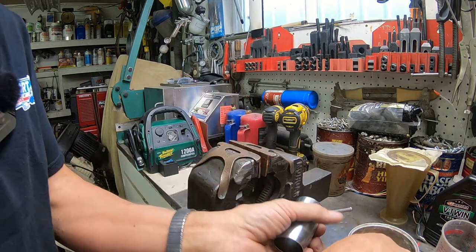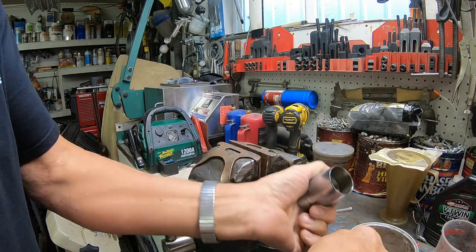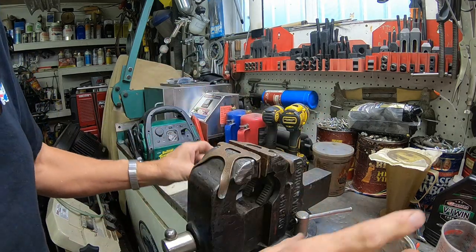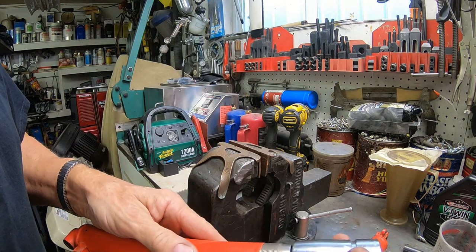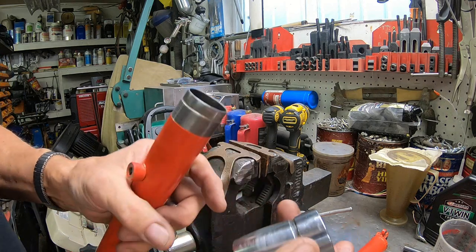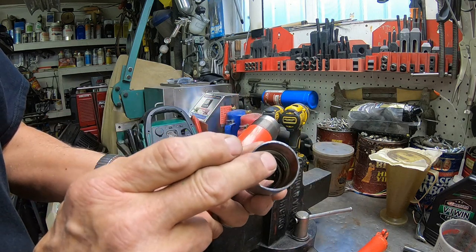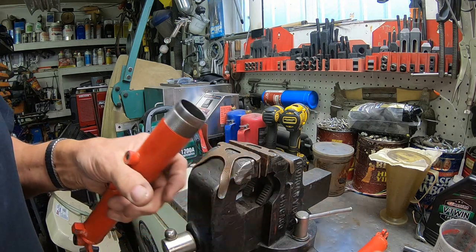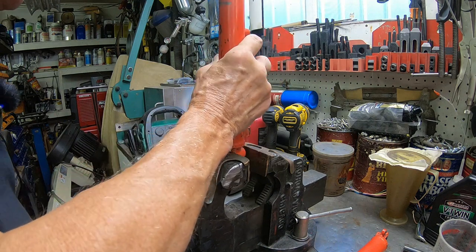Now I'm just going to get a little grease down here on my o-ring. When this screws onto here, that's what seals this tube — the tube has got a positive stop up here at the top and the o-ring is going to seal right around here. So we'll put a little grease there too just to facilitate everything.